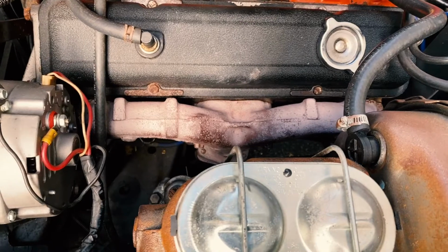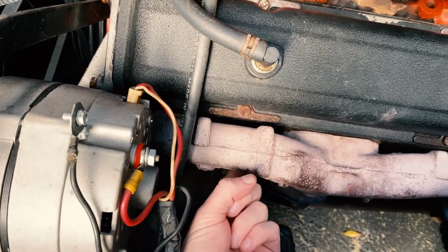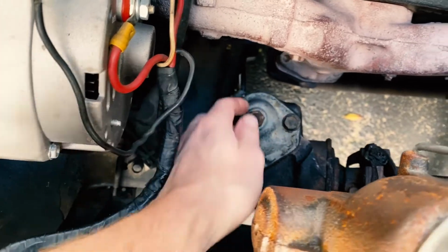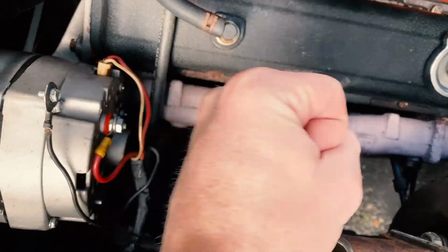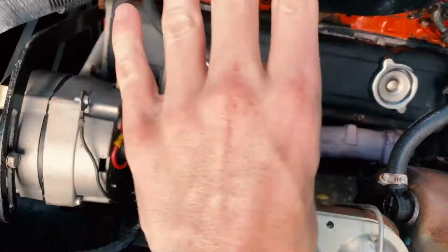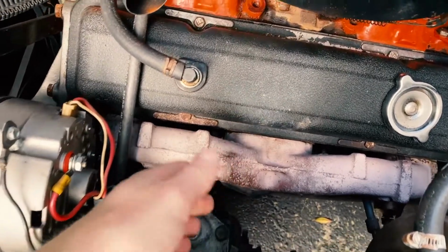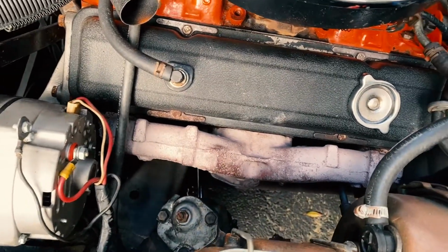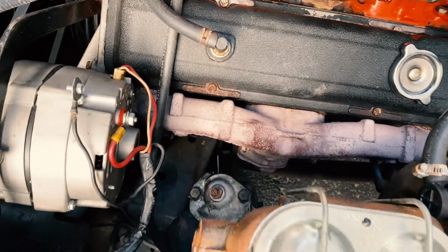The reason that happened is that each of these spark plugs was a little bit of an adventure on its own. So that one happened to be right down here below this exhaust. I think that's a header. But it was at an angle where this thing, whatever this is, was in the way. I couldn't quite get my tool in here easily. So what I tried was I put on a universal joint and an extender, and I was pulling, and it was at a weird enough angle that so much of the force was not just rotating. It was pulling on it to the side, and the thing just snapped right in half. And what I learned from that was it was so much easier to just put on the socket, then get my tool into place, rather than having them both connected and just trying to plug it in right off the bat. That was a thing that I used throughout the other side many times too.